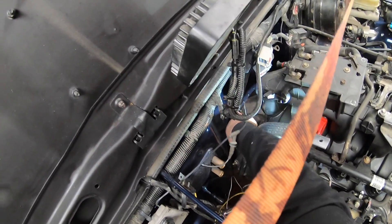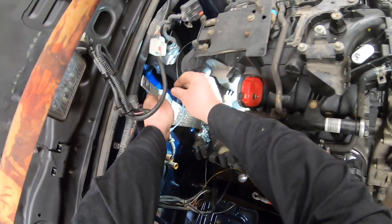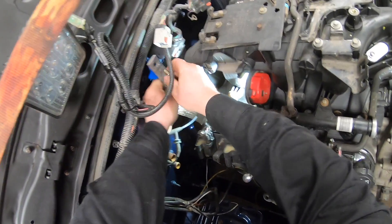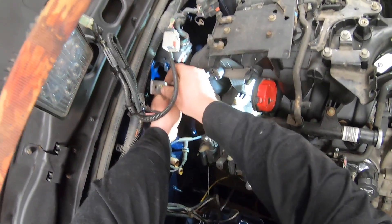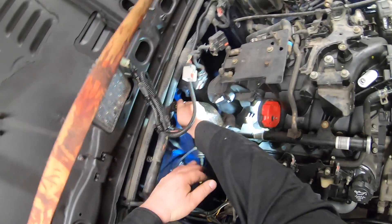I'm going to go off the top corner of the cylinder head. One thing you want to do is make sure your ground strap — especially from the engine — is not too tight, because there's going to be some flex in the motor.